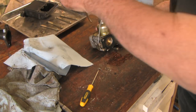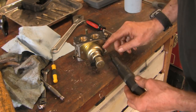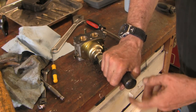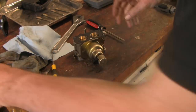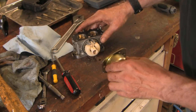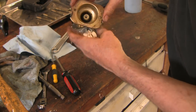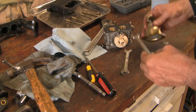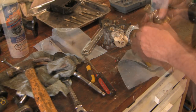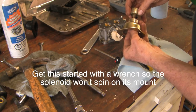Let's take the bowl off now. This one was stuck and I didn't want to put heat to it because of all the sensitive structures and seals underneath, so I used the impact hammer — put it in like this, turn it counter-clockwise, whack it with a hammer on the end, and it breaks free. Look at all that dirt in there. The thing about expensive tools is they tend to be quite thick, and where you need to get into a tight space sometimes they're just not adequate — so it's nice to have a cheap thin tool set. Hold this steady and then spin it off. Wow, look at that.